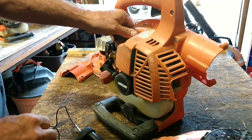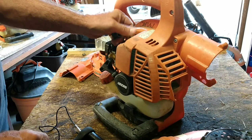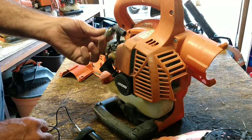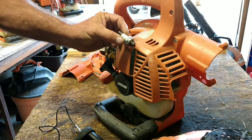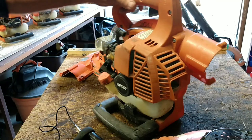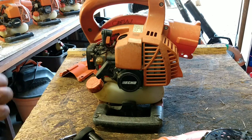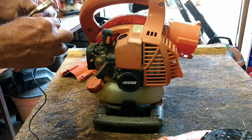And then also, you want to know a sad story? I was going through some of those engines over there. Had one with really, really good compression and all that fun stuff. See, this thing's just oiled out. Spark plug's fairly new. So we've got to figure out why this thing ended up over here. Anyways, they cross-threaded the spark plug.